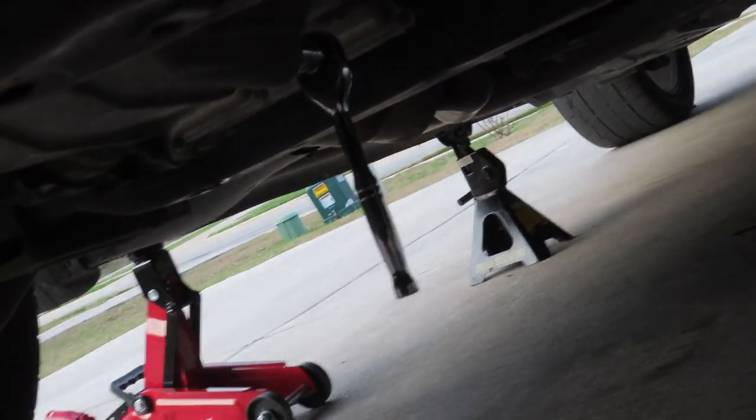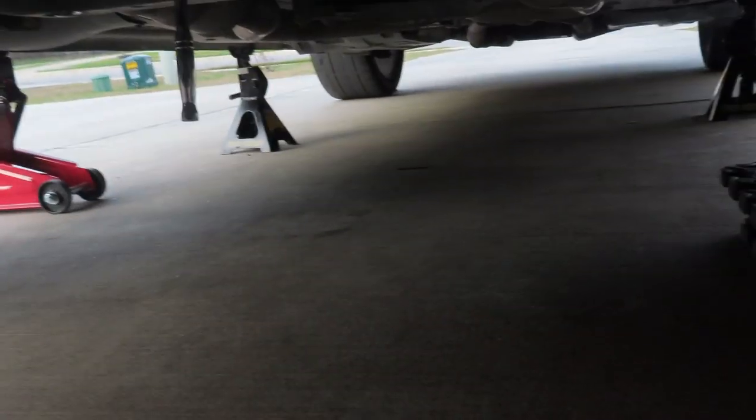You're gonna need a 13 millimeter to take that off. So I'm gonna swap it. And your oil filter is right next to it. It's pretty simple. Okay, I went ahead and swapped it to the 13. And now I'm just waiting for my brother to bring that pan so I can empty the oil and take the filter. So that's really about it.